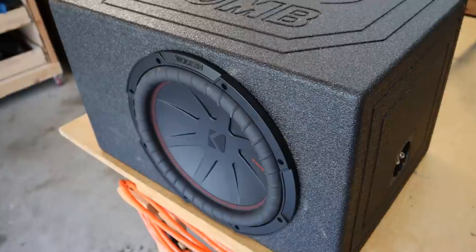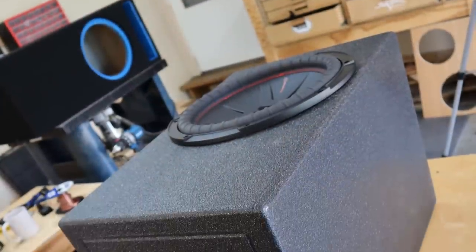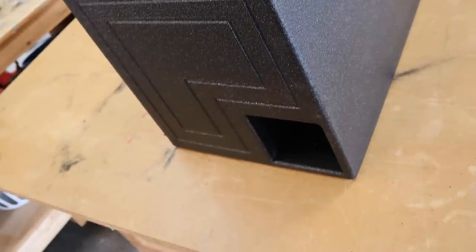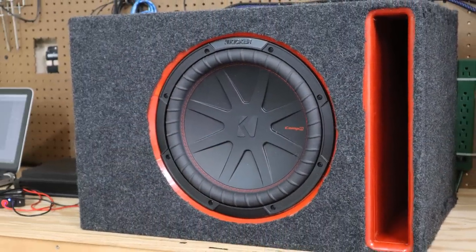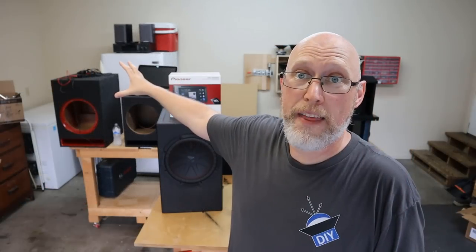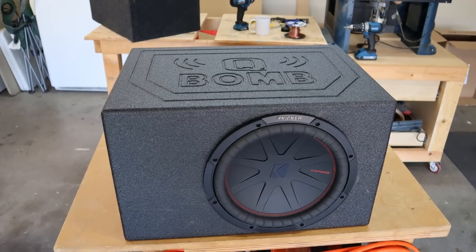I don't have a bass van or something to test these out in right now — all I've got is the quad cab Dodge truck. When I do these tests it's just sitting on the back seat, which is a terrible place to put a subwoofer. The back seat is going to give and absorb power. With the Q-Bomb box sitting on the back seat, the box is shaking on the seat quite a bit. My homemade DIY box, on the other hand, is heavier — 0.7 cubic feet bigger, more wood, port, and bracing — it didn't shake as much, so I'm getting more output out of that one.